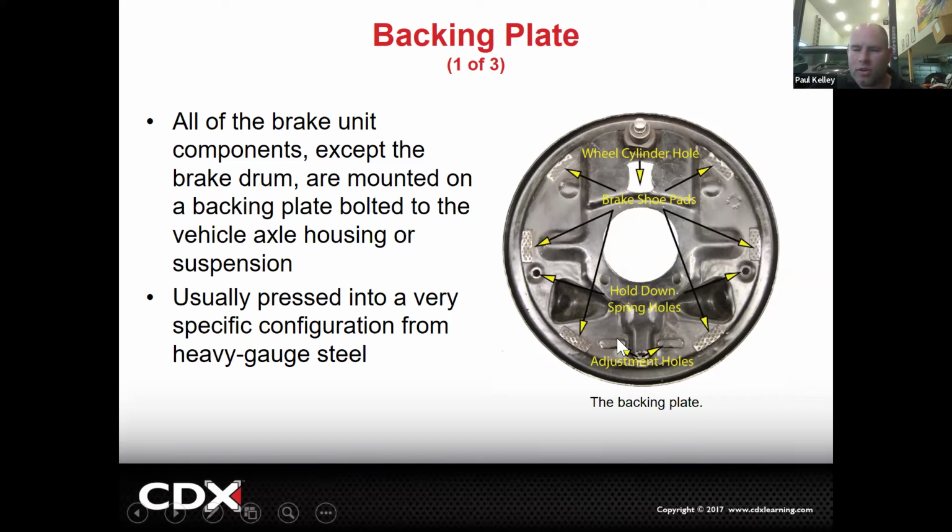Drum brakes tend to be a little more forgiving than disc brakes, and that's mainly because with drum brakes we're not having a lot of rubber seals that we're greasing up, whereas the guide pins and calipers have the rubber down in the bottom. We're worried about any petroleum because it's going to swell the rubber. You could probably get away with a typical petroleum-based grease here, but it would have to be high temperature. Sometimes you'll see grease that says high temperature brake grease, and you think, oh, it's perfect for brakes. No, that doesn't mean it's good for disc brakes. They really more mean it's good for drum brakes, because drum brakes are just metal to metal. If it's petroleum-based, it's a no for your disc brake guide pins at least.